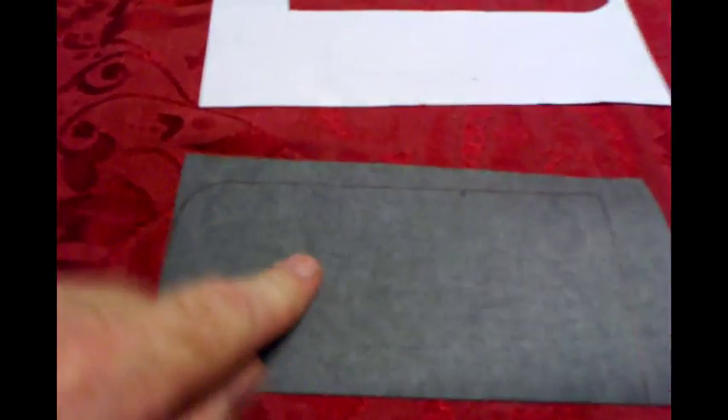Now you can see my line. I've used the manufactured edge there and the manufactured edge here for the gasket, so I only have to cut off this corner and cut down here. This corner on our template — you can see that the edge just extends. That's because the metal between this tappet cover and the tappet cover sitting over here is continuous — it's flat. So we can cut that anywhere we want after we have the inside edges cut to match the tappet cover itself.